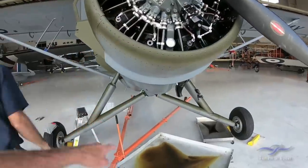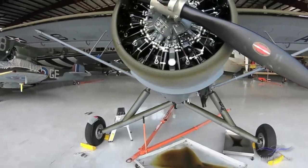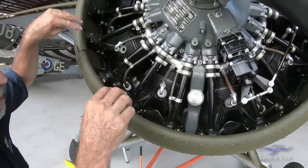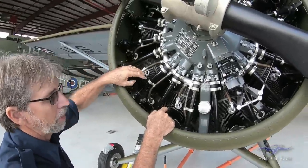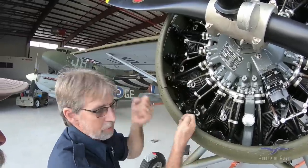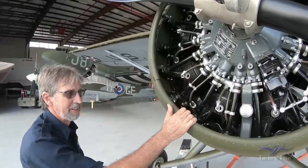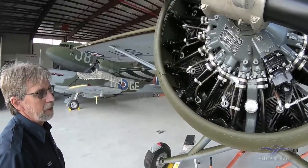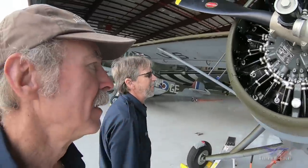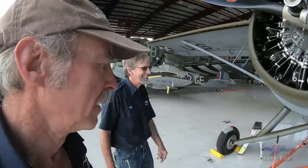We know for a fact there's nothing in the intake tubes because this has all been drained and we've closed that little deal there. But Jack, you were telling me about this other special thing — a lot of times you look in with a flashlight, and if you see oil in there you can't get it out. I use a syringe — like a turkey baster — with a long hose to go in there and suck the oil out. Whether you can see it or not, just stick it in and see if you can get something out. That's a Jack patent, I think.